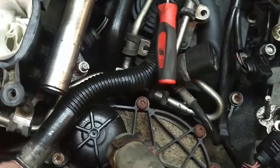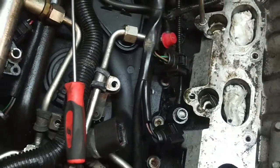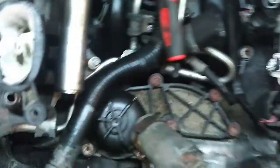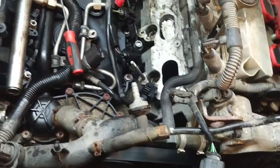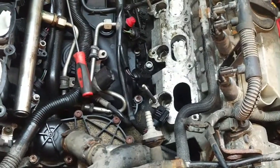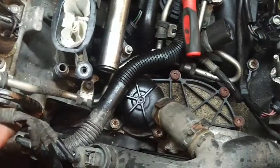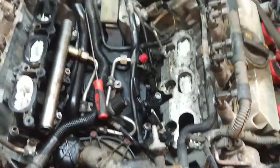I'm also going to smoke test this air injection line right here, which is for the air injection system, to make sure there are no cracks and leaks in it — that's a common problem apparently. It did have a problem with the air injection pump, which lives down underneath the right headlight. I've got that on order, just trying to be proactive. There could still be carbon deposits in the air injection ports, which is apparently very common, but we won't know until we fix the air pump, put this all back together, and see how it runs.